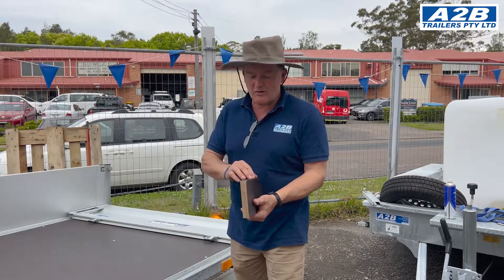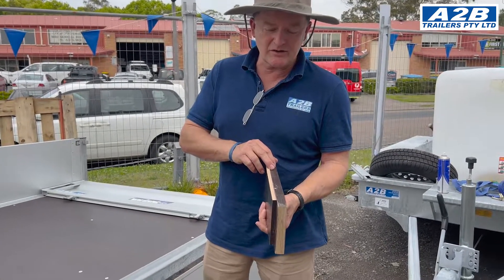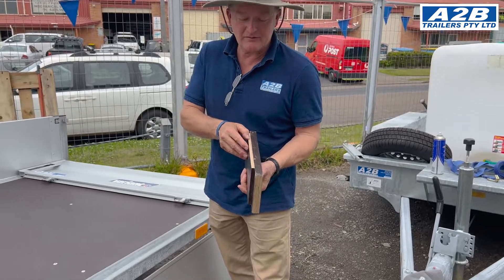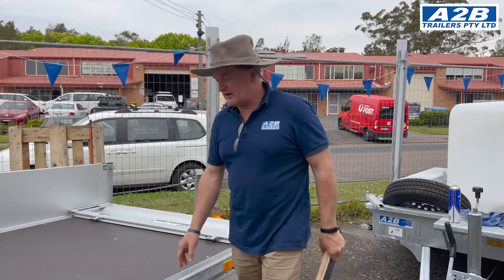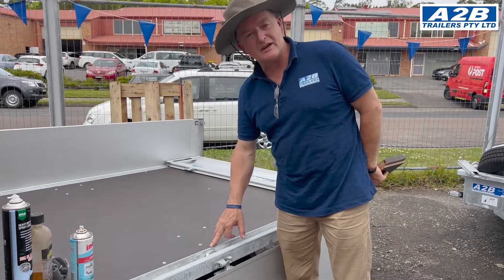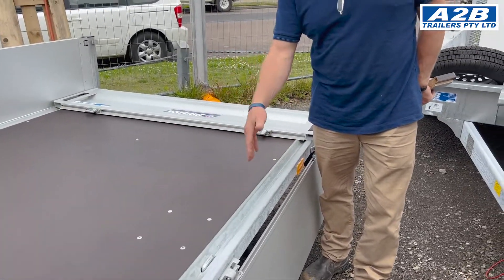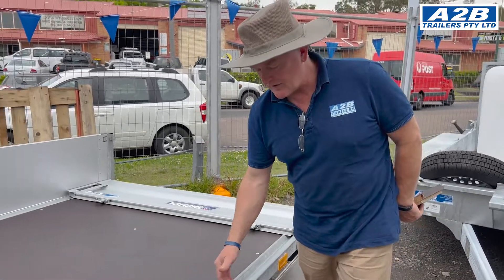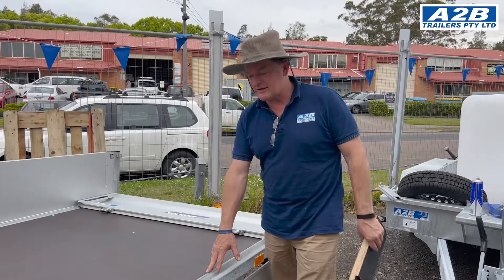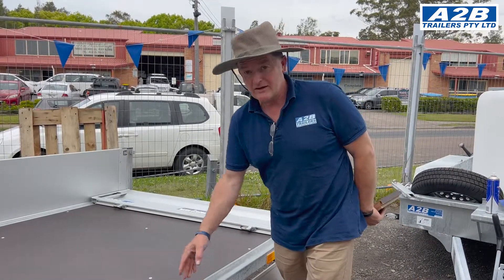The sides will normally be completely sealed prior to being put on the trailer, so as to protect the individual layers of veneer. When it's mounted on the trailer, all good trailer systems will have a complete rubber seal or silicone sealant all the way around the edge, which will stop soaking in and keep water from penetrating down the sides. This also allows for flexibility between the two different materials of metal and ply.